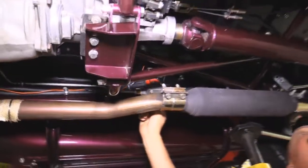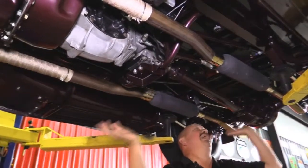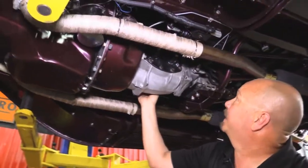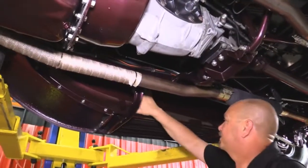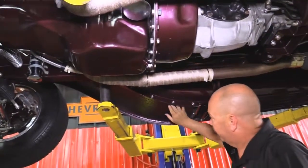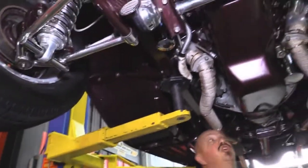We've got a Holley Red here pumping up the fuel. Really nice job on the brake lines — they're all clipped to the frame. The frame's been boxed with diagonals going in every direction for the crossmember. Parking brake is hooked up. Good looking crossmember here for the trans — it's a Richmond four-speed. Beautiful paint on the inner fenders and inner running board. The rear fenders are steel and the front fenders are steel on this baby, and they've been coated with a bed liner material to protect against chips and paint damage from tire debris.